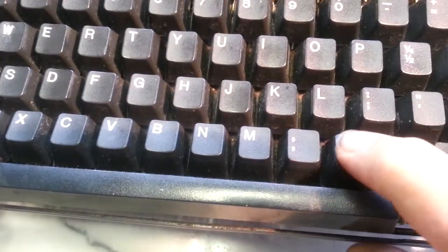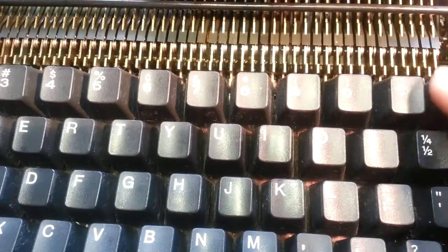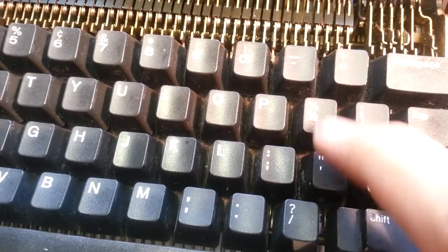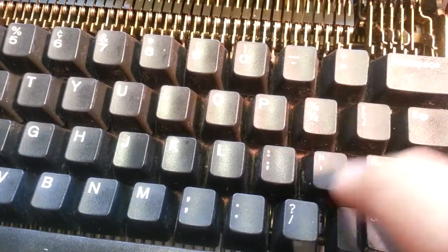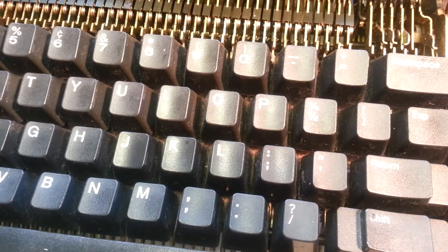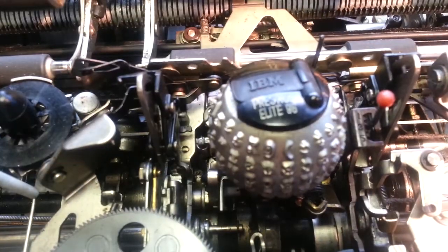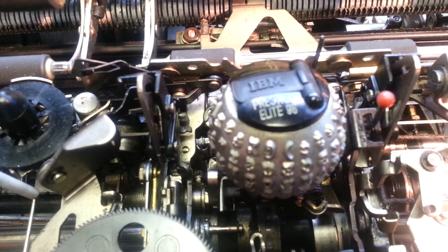the period, comma, dash, underscore, and some of these other characters here. Otherwise, they will punch a hole right through the paper, through the ribbon, because they hit too hard. So what that cable does is it lowers the impression of the ball, hence dual impression. But these do break on a very regular basis,